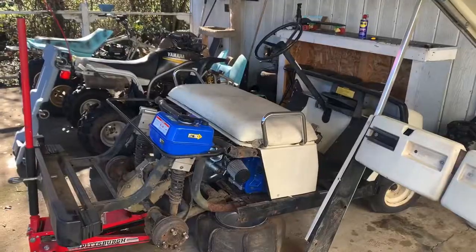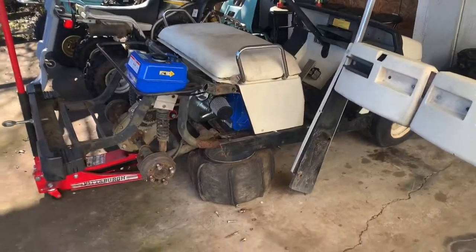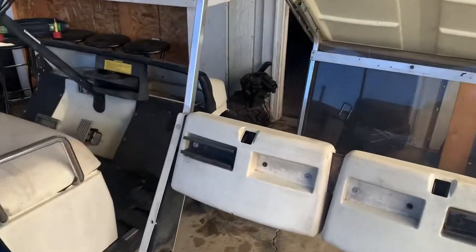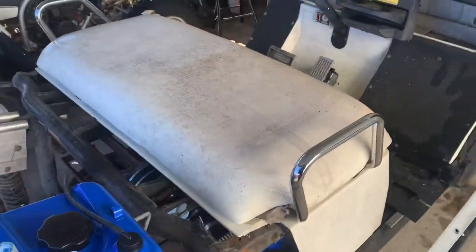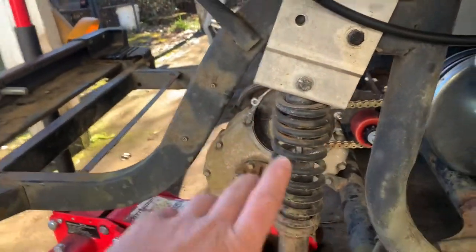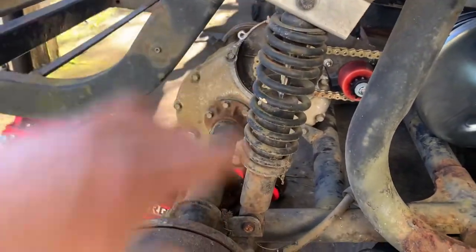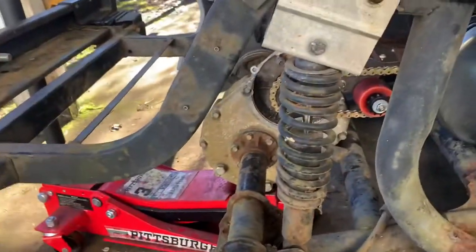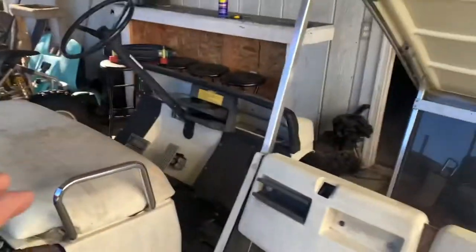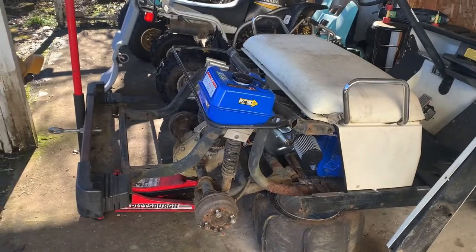So this is where I'm at right now — I've got the top off. I kind of dig the look but I do want it a lot lower. What I'm thinking is getting rid of this custom two-inch lift and then cutting the spring so it still has a little bit of suspension but lowers it, probably about four inches. Then for the front, just cut the springs roughly the same amount.